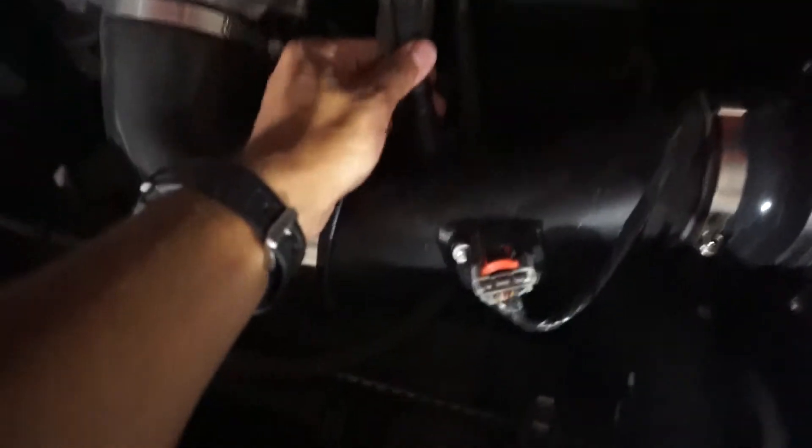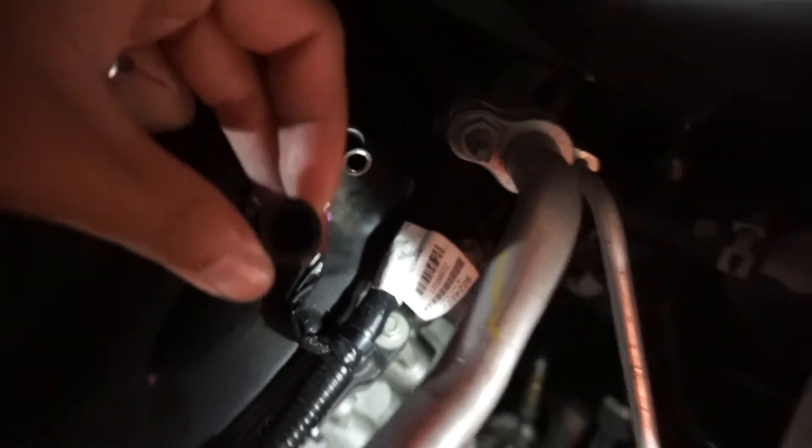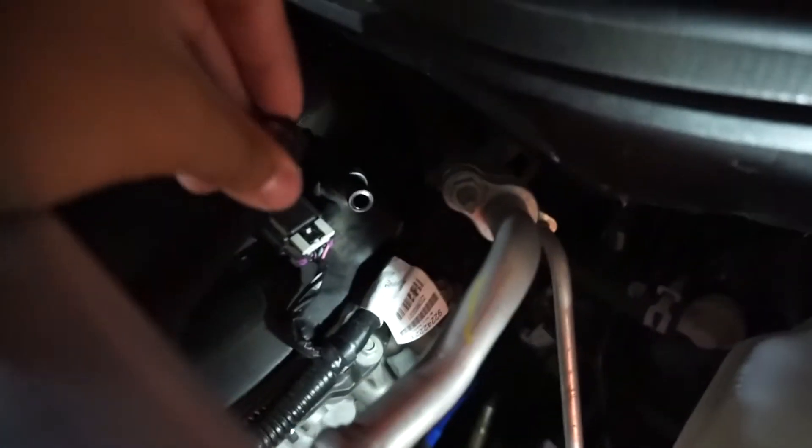So we're going to take this tube off — if you have a stock air intake, it literally just slides right off the back. We removed it; it goes all the way back to this open port that kind of swivels. The cap that comes with the kit is pretty small but you can stretch it on. Some people say you don't need a clamp, but I will be putting a clamp on anyway because I don't want to risk air being sucked in from two directions or oil spitting out. Work it on from one end and tighten the clamp. That is now on with the clamp, tight.